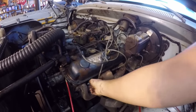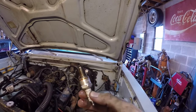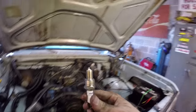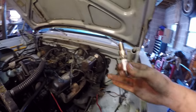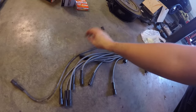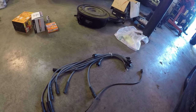I've already loosened this one up. There's an old plug — it's got a little bit of oil on it, which isn't a big deal, and it's a little sooty. I've got these new Autolites already gapped to 35 thousandths, and I'm going to put that in. When you swap plug wires, lay your old ones out next to the new ones and stretch them out to find the closest length match.